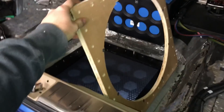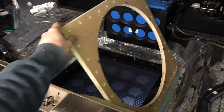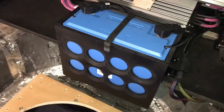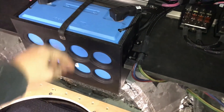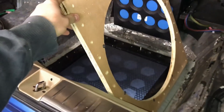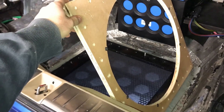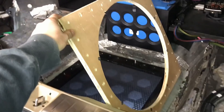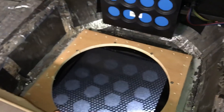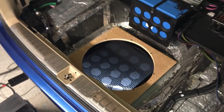That gives an extra difficulty to the whole fabrication. I also had to move the battery up because now I only have just enough distance between the manifold and the battery rack — before, the battery was nearly an inch further down, so I had to relocate the brackets. There's definitely no space for any bigger sub than this in the future — no 21 or 24, forget that. But I'm sure these two 18s will do the job. That's day one, and hopefully I can show more progress tomorrow.